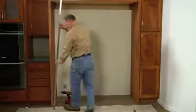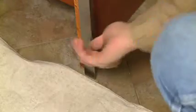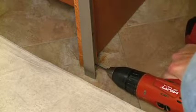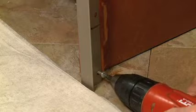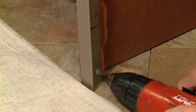On the cabinet trim's left side, position the left side trim. Make sure the trim is resting on the floor. With the trim in position, use the drill to make a 1/8" pilot hole. Install one 5/8 screw until it's completely seated. Then remove the screw.